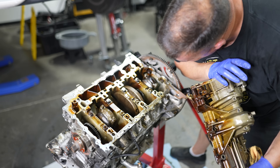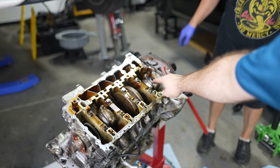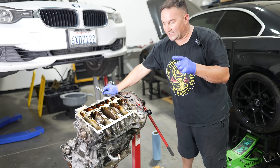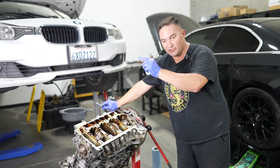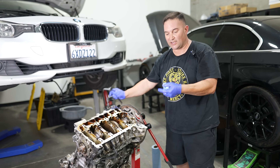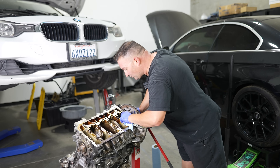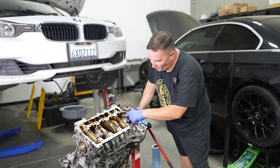As Joel had predicted based on his relative compression test, we have cylinder number four showing discoloration — and there's your knock. I was saying that every time on number four on the way up it wasn't smooth; it had a little bit where the resistance increased and then decreased, and that normally means it's having a binding problem. It still spins around, but we're probably going to have to get a new rod because you can see that this is so hot.